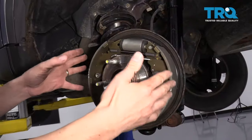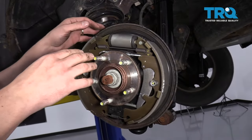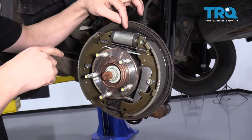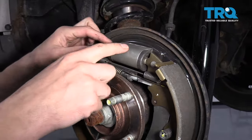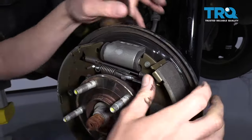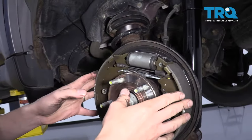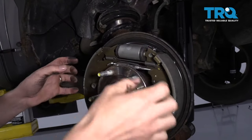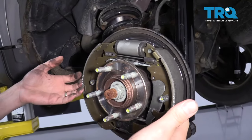Here are your brake shoes — your front shoe and your rear shoe. When you push the brake pedal, fluid from your master cylinder goes through the brake hoses and into this wheel cylinder. When the fluid builds up in here it takes these shoes and pushes them outward on each side, grabbing the drum. When your brake shoes wear down, no matter how much they push out the brake shoes aren't grabbing the drum, and therefore your brakes aren't working very well.